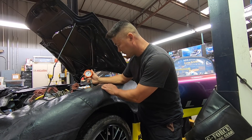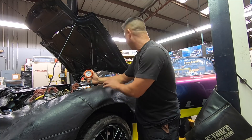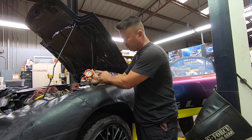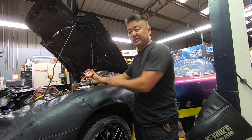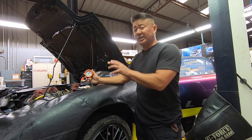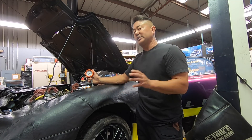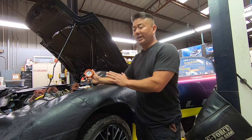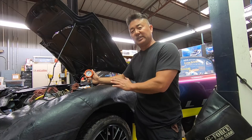Go ahead and hit it. All right, so what we saw from that is all the pulses were consistent — they were hitting 75 pounds. So the engine is probably okay, at least in the rear housing. The compression seems a little bit low in my recollection, but let's go ahead and check the front for comparison and see what we get.